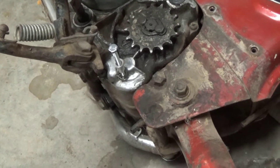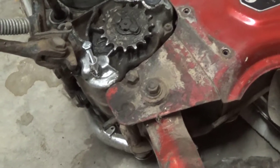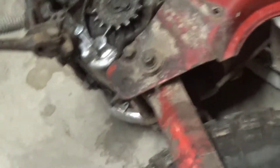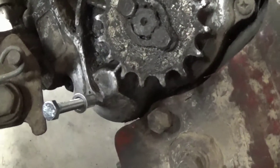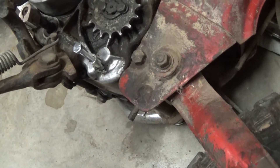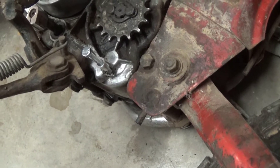Now all I did is clean it up. I got a little wire brush and some carburetor cleaner — any brake parts cleaner, any type of cleaner like that — and just cleaned off the area. Then I got a bolt with the correct threads and threaded it into what was left, although it's hard to grab and keep straight. In this case I just put it there so that I can look at how much I've got to drill out. It's not very much because the rivet is kind of thin anyway. I'm not going to drill all the threads out because I want to use part of them to help line up the bolts so that once you put the side cover back on, the bolts go right in the hole.